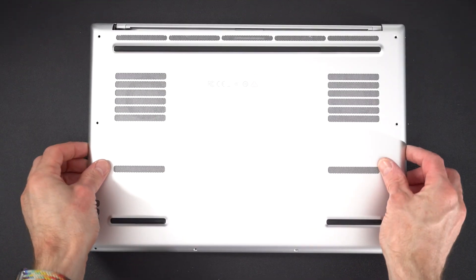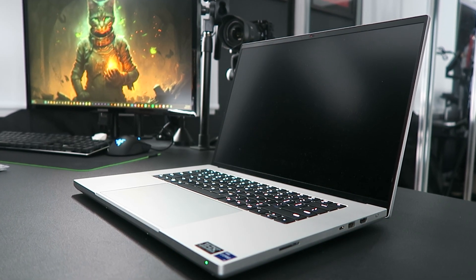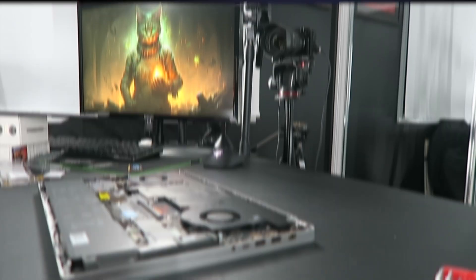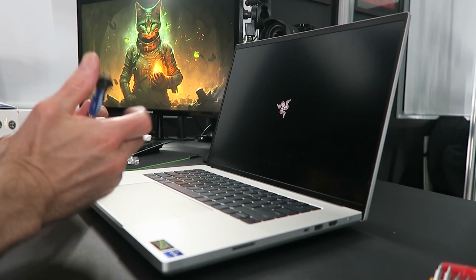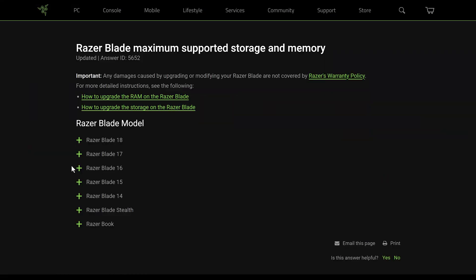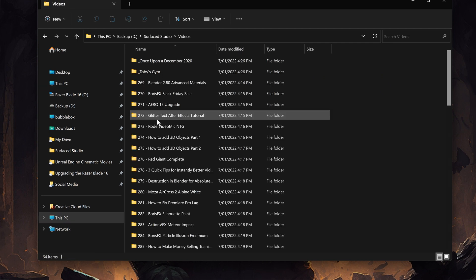And that is it! The last part is putting everything back together. I highly recommend only putting one or two screws into the back cover first, just in case something doesn't quite work as expected. Say a little prayer to the computer gods and turn it back on. I personally had a little heart attack because the laptop didn't turn back on — it stayed on a black screen, the fan was spinning, and the power light was flashing but nothing came on the screen. After shutting it back down, I opened it up and swapped the sticks around to see if I had a bad stick, but my RAM sticks were fine. I was simply being too impatient — due to the RAM swap, the first initial startup simply took much longer than expected, about one or two minutes. Eventually the laptop booted up, the Razer logo came up, and everything started normally. Checking my system information, I can now see 64 gigabytes of RAM running at 5200 MHz — on the official Razer website it says the RAM will auto-scale down to 5200 MHz, so I'm just throwing that out there in case it catches you out. The new SSD also showed up with all of my files, so everything was fine.